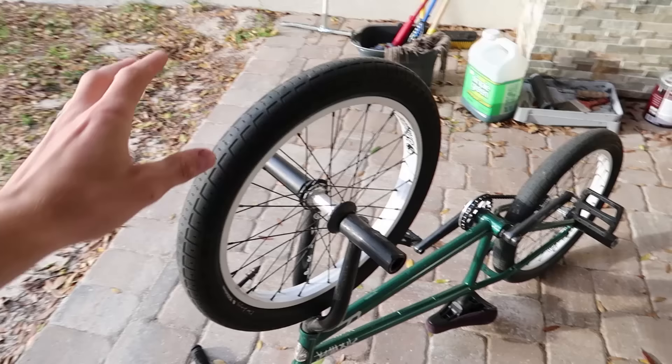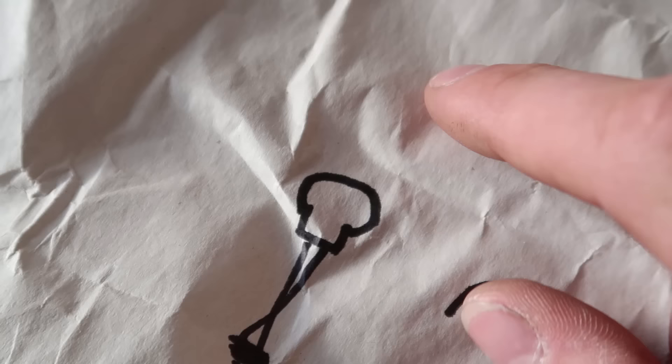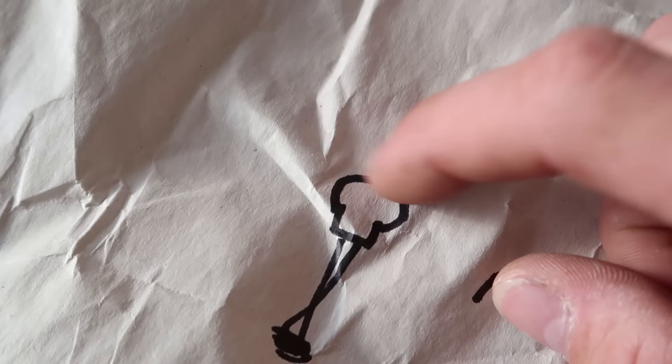The next life hack I'm actually not going to show you because I'm lazy and I have no reason to do it, but I'll explain it. If you ever get a flat tire and need to ride home, there's a trick where you take both sides of the bead off the rim, so the rim is kind of inside the tire. You're able to ride home on that thin layer of rubber because it's a lot easier than having the rim on the bead and having the tire sponge around underneath it. Normally the tire sits on the rim, but when you get a flat it sponges down and wobbles to the side if you try to ride. So you take the tire off the bead and just have that flat piece of rubber that lets you ride home.